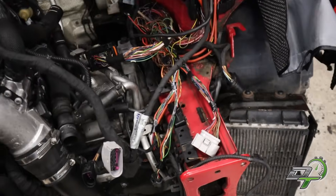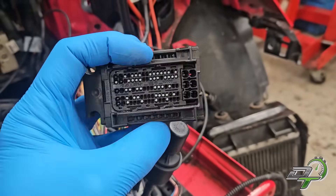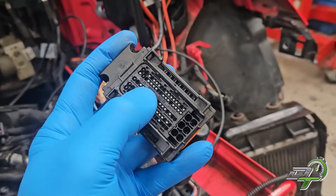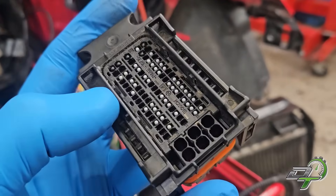The way I've done this is the most logical way I can think of. I marked up the wiring diagrams, got them in my head, and tied them to the RS3 loom when I stripped it. The reason I stripped the RS3 loom was to get the T91 connector — because the T91 plug on the RS3 comes with little blanks for pins that are not used. That's pretty useful because you know which ones aren't going to be used, and I was going to use that plug anyway — I just had to populate the positions where the blanks aren't.